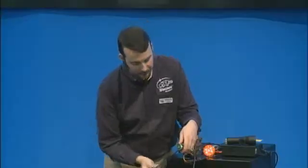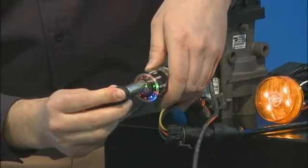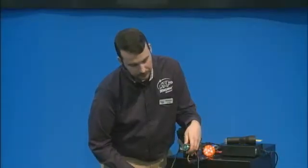Watch what happens — I'm going to place the magnet over the front of the unit. See all those lights light up in the circular pattern? Now when I remove it, the unit fixed itself. Essentially, I've reconnected the sensor — it has a new sensor on it. I've now actually cleared what we call an active fault code. So the system had to be reset via that little magnetic tip on the front.